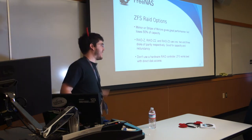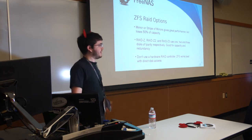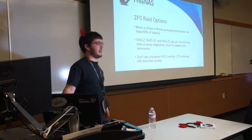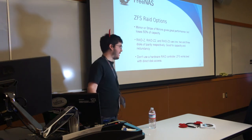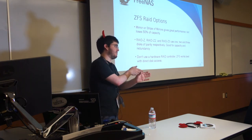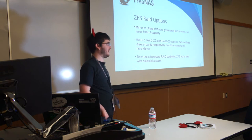The mirror or stripe of mirrors is the easy button — especially if you have two identical disks, or different sets of two identical disks. Put them together two at a time. It'll automatically stripe everything as evenly as it can, benefiting from the performance of having two disks and the parity of having every disk backing up another disk. If you don't have identical disks, the closest-sized ones can be in a mirror and it'll cut off the bit that doesn't match. This is the most common way to get decent performance and protection on an unplanned NAS setup.